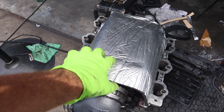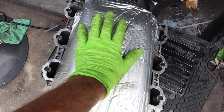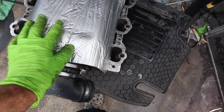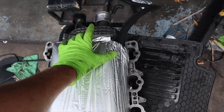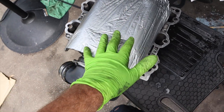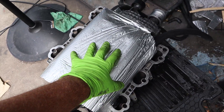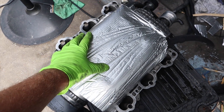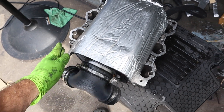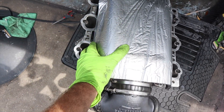The lines that we put on there are super easy to install. I want to get the lines coming out, then wrap the whole intercooler. We got the blanket cut up and on there — it doesn't stick the best on the curves but really good on the flat sections. We're just going to push it down hard and put it right back in the car. This blanket should help insulate and help radiate some heat away — it really can't add more heat.